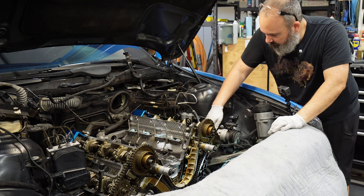This is coming together really quickly — I'm liking today's progress. You don't have to drop the subframe to do the engine mounts; it just happened to be when I'm doing them here. You've got two 13 millimeter nuts on the bottom that hold them to the subframe and that one 16 millimeter nut that holds it to the engine bracket. You can see with these motor mounts they were totally toast — cracked all the way around, leaked all over my driveway. Really was important to get these done now — well worth the investment of time.